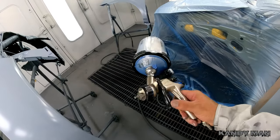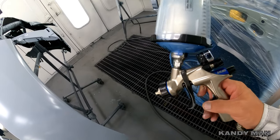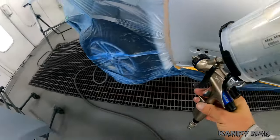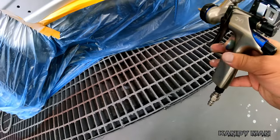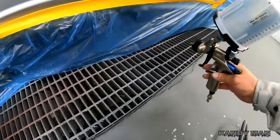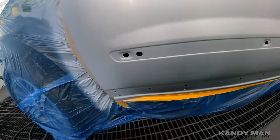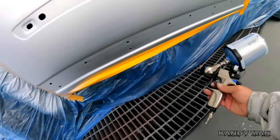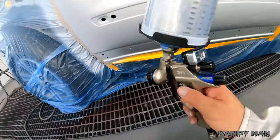We're all loaded up, we've got our base in it — this is 636 with the DV1 and the 1.4 head. One of the great features I love about it is no regulator, because when you get down low and you're spraying something low, you've got to bend that hose all up because you've got no room to get it low with that regulator extending it down even lower. Especially on lower vehicles, you're actually turning that gun sideways to try to paint, and that applies to the DV1 clear as well.